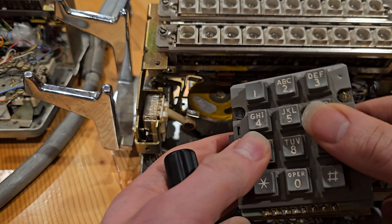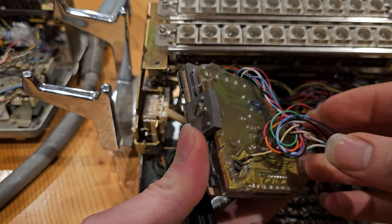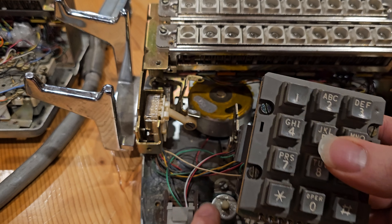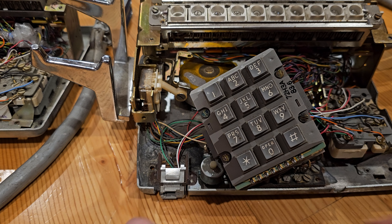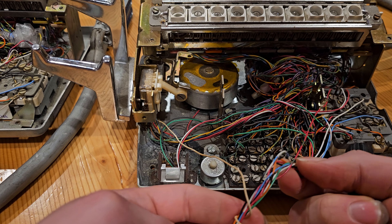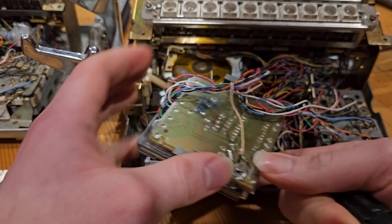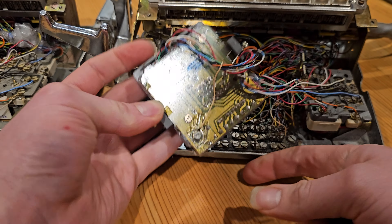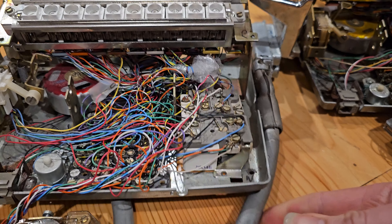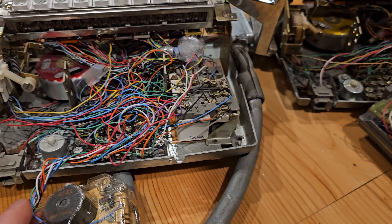I prefer the older mechanical style dials, but these are more of a modern style. You can see this one was made in '83, but all the phones you'd see in the '90s or something would have something similar to this, or even worse, those gel buttons. Anyway, this dial is not standard Western Electric issue, so the wiring for this dial is different from this one. We're going to disconnect the 35AF3A first, and I might start just moving the wires over to the next phone so I don't have to go back and watch my own video on how to connect it.